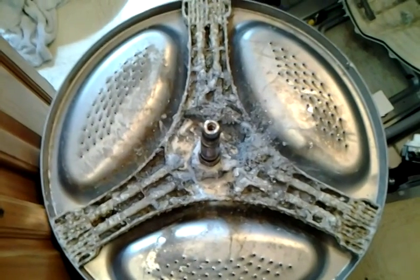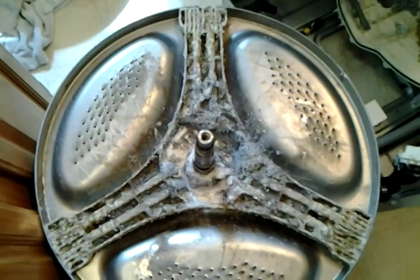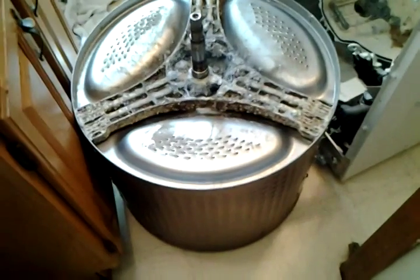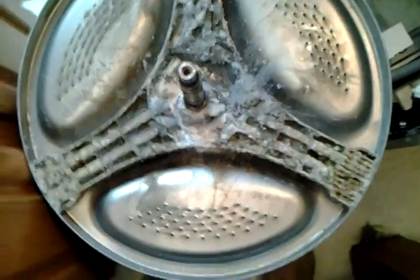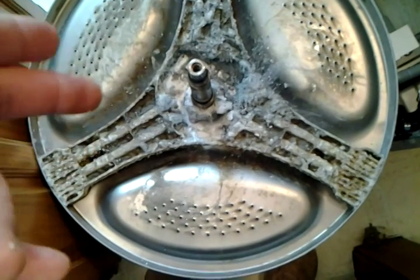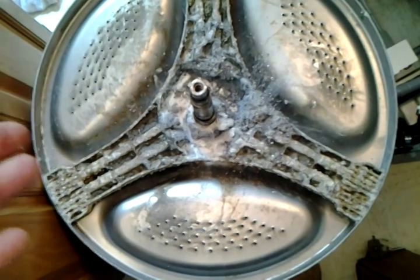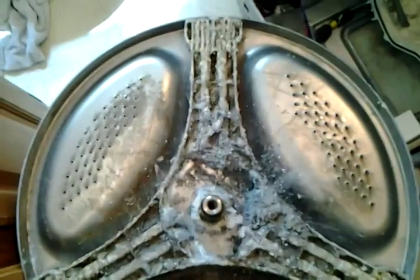But I mean, this is just engineered obsolescence is what this is. When you've got two dissimilar metals like this, you've got, I guess, the anode and the cathode, and the water in between is the electrolyte, and the electricity passes through, and the weaker metal, which is the alloy in this case, is the one that's going to corrode. So common sense tells you when you have dissimilar metals like this coming in contact, you should paint them. The stainless steel isn't going to corrode, but the other metal will. So I mean, they could have at least painted that piece.